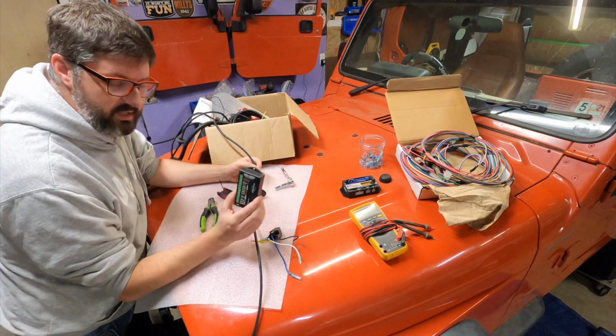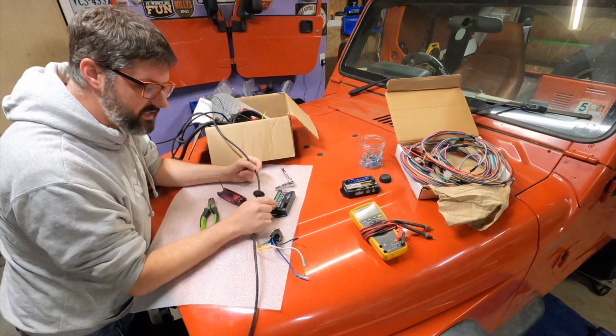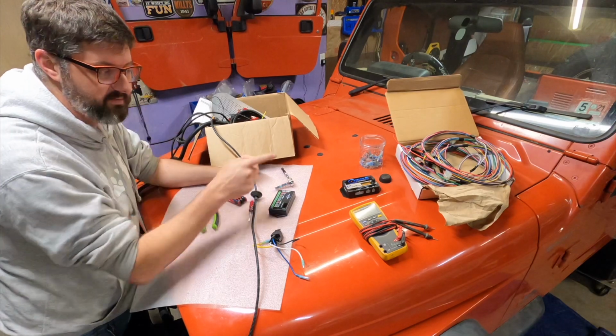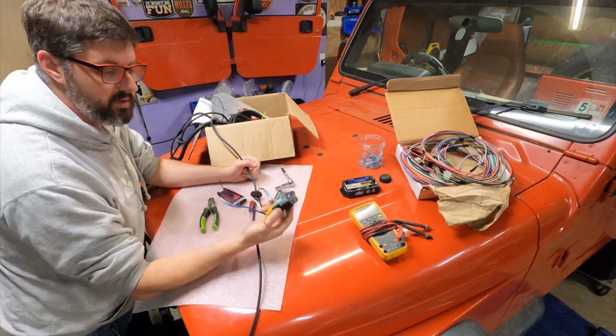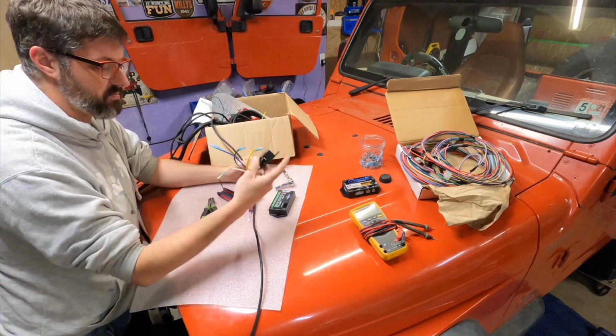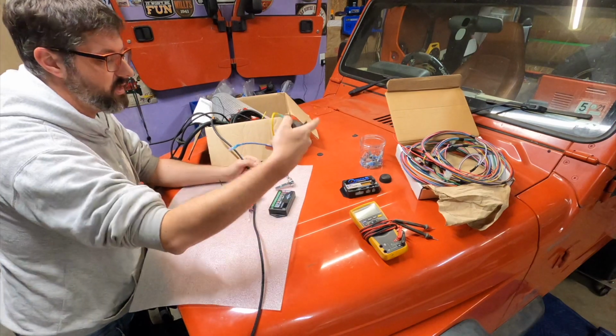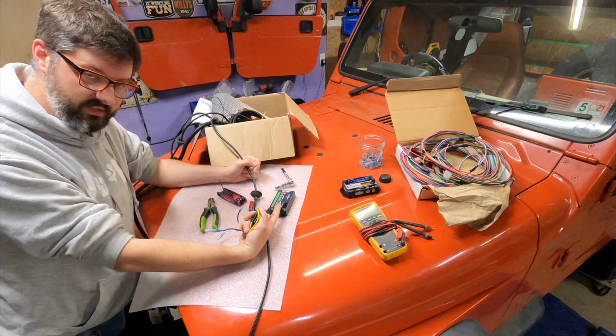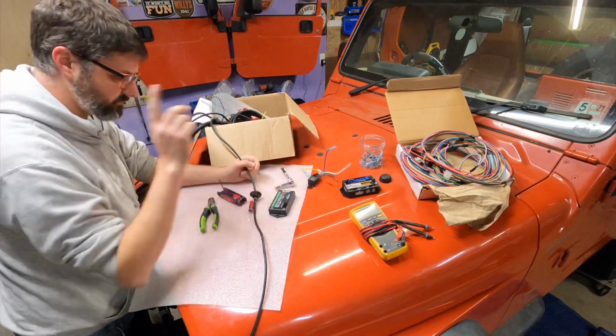I've got my signal box off, which I need to convert my alternator signal to a tach signal, which I have to have for the Quick 6. I'm going to reuse this relay, which is going to supply key switched power to both the Quick 6 and the signal interface from Dakota Digital.